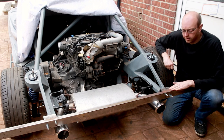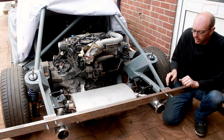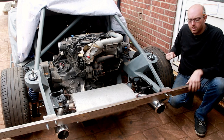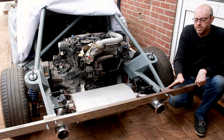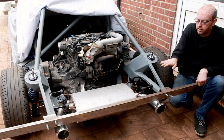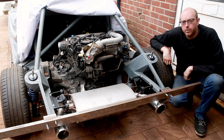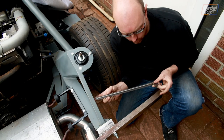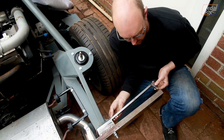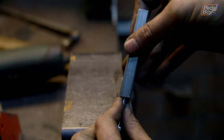Once the core of the bumper is done — it's all welded up now, the extensions are in, and it fits quite nicely onto the back of the car — we need to work on the extensions that are actually going to hold the arch work around the rear wheels. I don't want them welded onto the bumper bar because this needs to be able to come off so we can get the engine out easily. It'll be welded onto the chassis and just bolted onto the back of the bumper for stability, the same way we did with the front. Last night while it was raining I welded up these little extensions with an M6 nut welded into some half-inch box on the end.